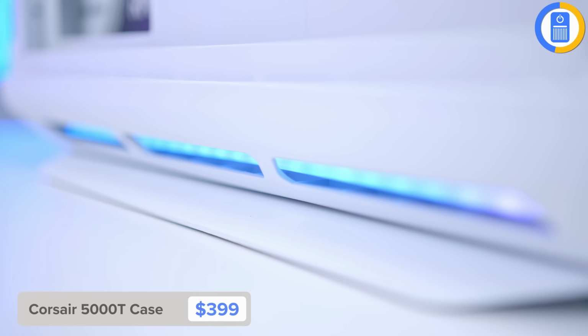Other components worth noting at this point include Samsung's 990 Pro. This is basically as good as it gets when you come to looking at Gen 4 NVMe SSDs, while 32GB of Corsair's Vengeance RGB Pro in all white completes the motherboard assembly nicely. 32GB of RAM is ideal, and you may want to opt to get this in a 2x16GB DIMM configuration rather than 4x8. That will give you better upgradability options over time.